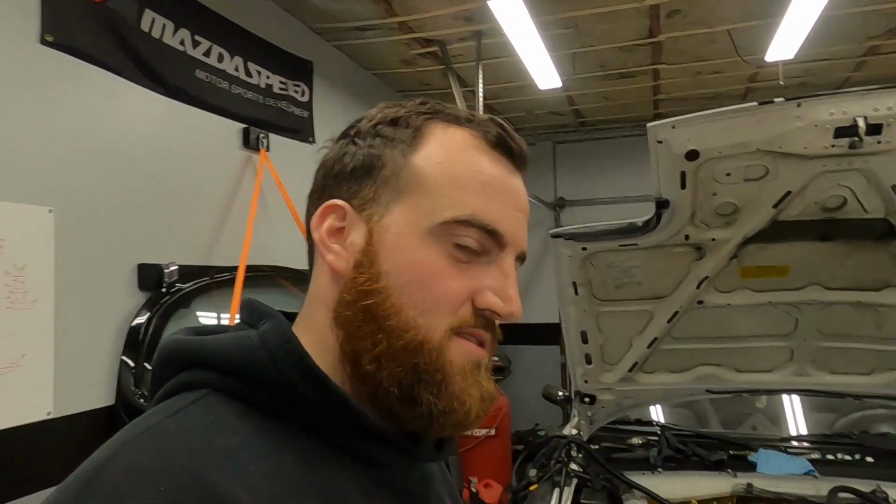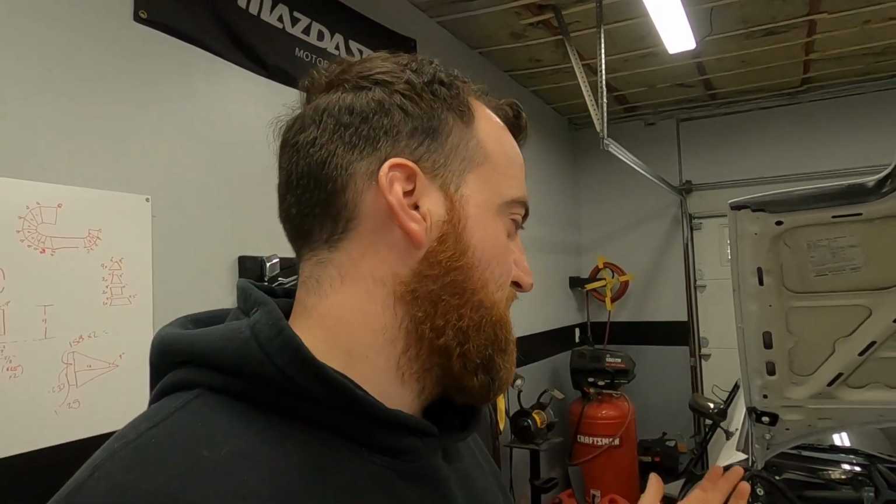That's not a thing with V-bands because of the way they clamp. They have a locking screw in them. They don't come apart. So even if they come loose, you have an exhaust leak, but it's just retightening a bolt. There's no gaskets to deal with and no nothing. It's so much better. And they look cooler. Everybody loves V-bands, so really stoked on how this turned out.